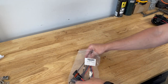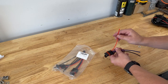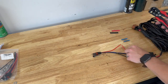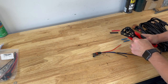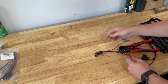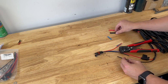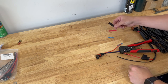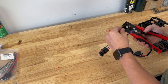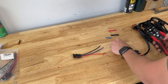These pigtails go for the lock-and-ride system underneath the hood. Red is constant hot, blue is for the ignition, and black is obviously ground. We're going to hook up to the red because we want it always constantly hot. We're going to take the wiring harness and cut our red wire off because we're not going to hook it up to the battery — we're going to set it up for plug-and-play instead.